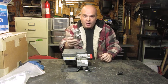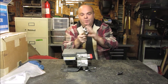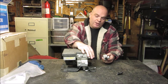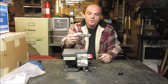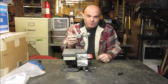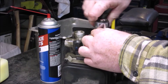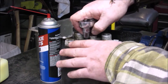Now if the leak is coming out of the front here, it's your pressure switch that's leaking — that's probably not your problem. Your problem is probably this. You do not need to take this out of your car; you could take this off while it's still hooked to your car underneath. You wouldn't even have to take off the three lines here, just the two lines here. And it's going to be a huge mess even if you bleed or take the fluid out of your ABS reservoir, so you're forewarned.